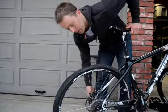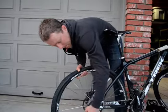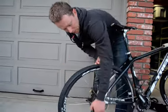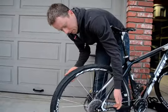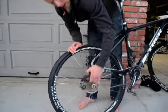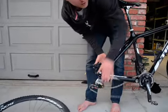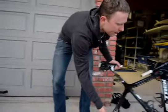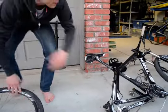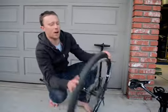Starting from the beginning: I've undone my quick release, and then all I do is grab the derailleur and push the tire out. It's tricky at first — basically, I undo the quick release, grab the derailleur, pull the spring out of the way, and the tire just drops out. That should work for road or mountain. Then I lay the bike on its side — if you're careful there should be no contact points.